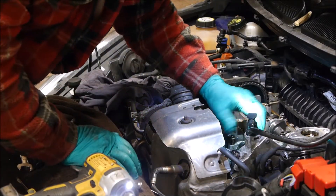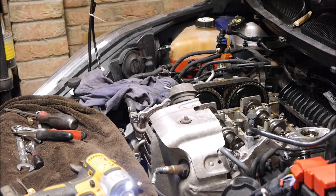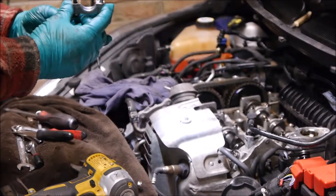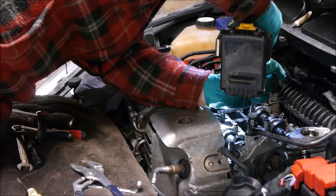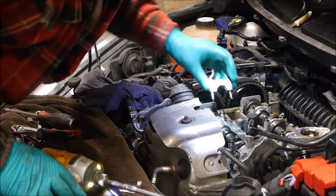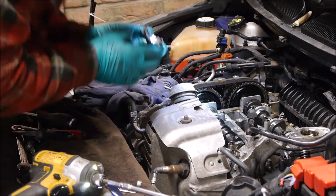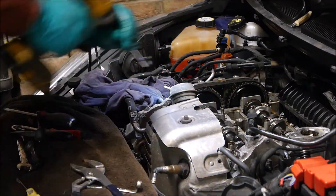The moment of truth - what does this cam bearing look like? Oh yes! You can see that it is oiled, it's not dry, it's oiled. I'll need to get the torque figures for these. Let's have a look at the next one. Again - oil, no metal particles. Bear in mind this engine has done 100,000 miles and that is not damaged. So far it's looking good. I've still got three to check but it's looking good at the top end.